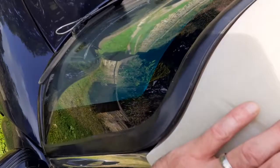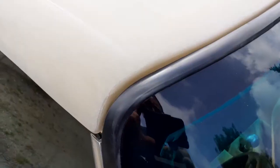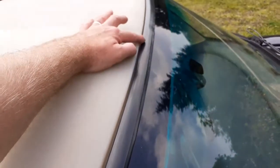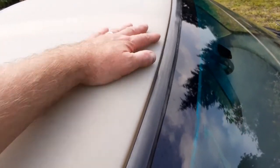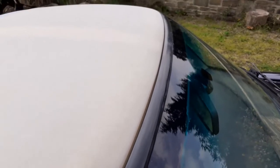There's a little gap there which will close up if I push it together, but what I've noticed is when I do that it opens up at the other side. Now I've pushed it fully home at the near side, opening it up at the far side tells me it's pivoting in the middle. I think I need to open out the fiberglass where the peg locates, because if I pull that in it opens it at the other side - yes, confirmed. So I'll open that out with the Dremel now and it'll fit a lot better.